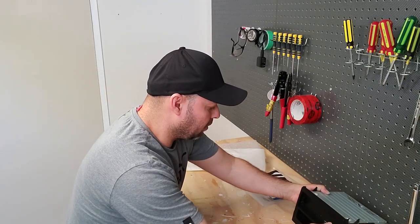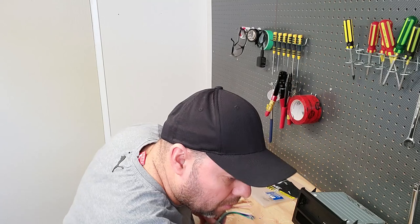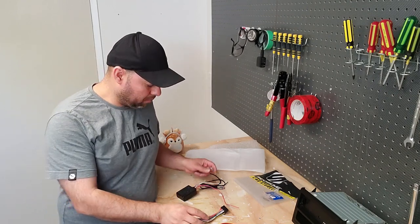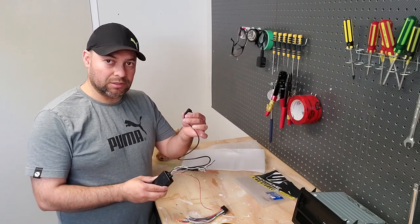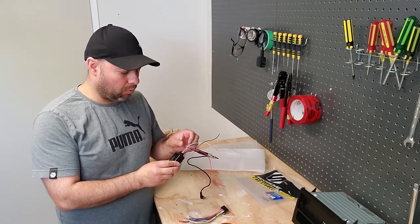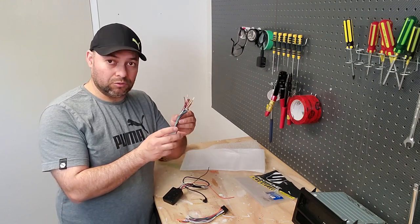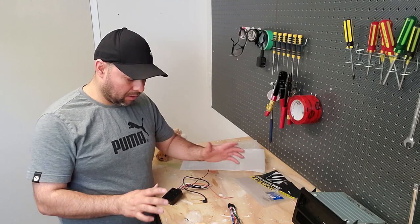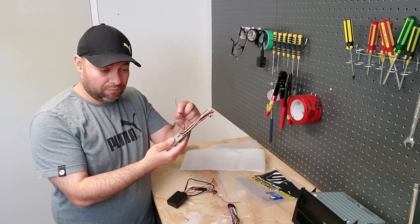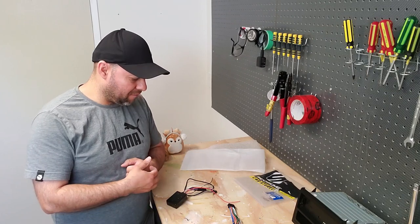So there's our steering connector, our factory radio harness, and the adapter harness. For the steering wheel controls on this Alpine, the signal goes straight to the back of the unit via a headphone-jack-type connector. We need the white/green wire on SWC1, plus a ground and power. The power and ground I'll connect in junction with the adapter harness. The green/white wire goes to the single bottom brown wire on the factory harness, as I showed you before.